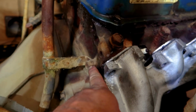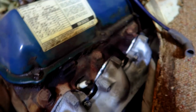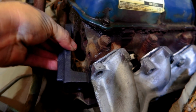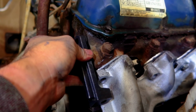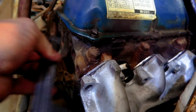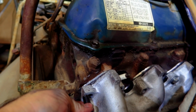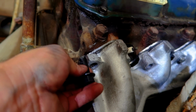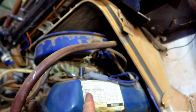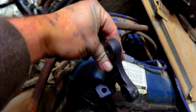What it's gonna do is I'll have to take out this bolt here, and I think it just utilizes this one and this spot, which doesn't have anything in it. And then it has a little arm that sticks out, so you can see there, and then it lines up with that hole. What this is supposed to do is you're supposed to be able to throw one on each end of the manifold and then shove another bolt through it, and it actually clamps onto like here. It doesn't actually go in the hole, it hits the side here and just pushes it against the block. This one flip-flops to kitty corner, the other side, the front driver's side as well, because it turns around and works for the other end as well. So if I need one over there, I can order another one of these.